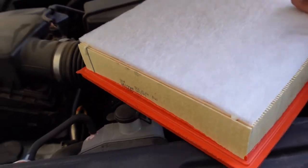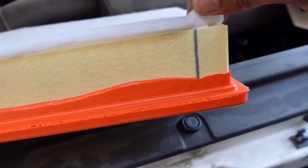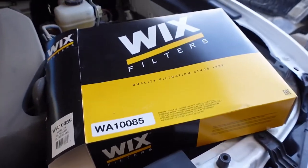It's just attached to the filter there. It looks like a couple stripes of glue. I almost pulled it off, but I thought let me double check and see what it is. So I looked it up and some people said that foam was there for northern climates to actually help slush and things stay out of the intake. Others say it's just an extra bit of protection, and once it's time to change your filter, you can pull that foam off and now you have a basically fresh air filter. Some say you can wash it and put it back — not so sure how I like that. I'm used to K&N filters that I reuse.